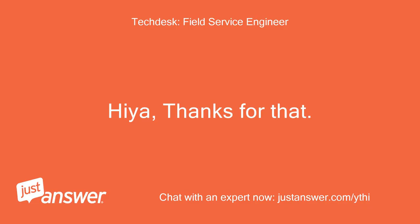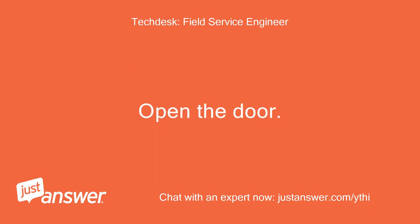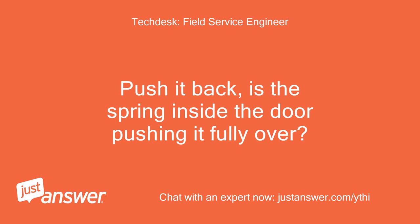Hiya, thanks for that. The symptoms you describe suggest a faulty door lock and/or faulty control board. Open the door. Look at the latch pin on the door. Push it back, is the spring inside the door pushing it fully over?